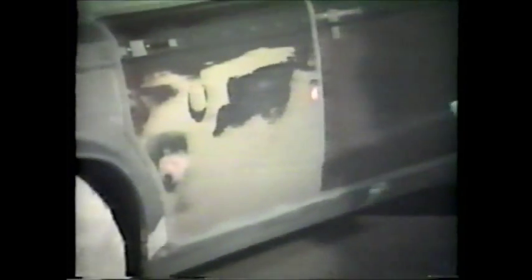A unique feature of the PMB process is its ability to leave body fillers in ready-to-paint condition, as this Bondo close-up shows. Note the factory-installed lead-filled door seams in original, virtually factory-fresh condition. The stripping of thin aluminum — unthinkable with sandblasting — is easily accomplished with PMB, as this shot of an aluminum Rolls Royce door indicates. The paint comes off easily with no damage.